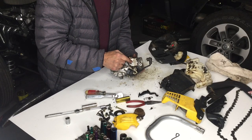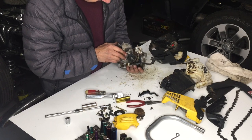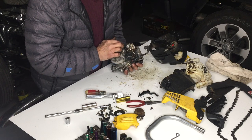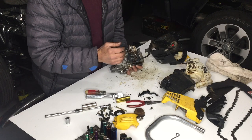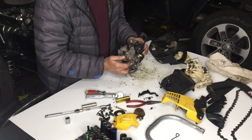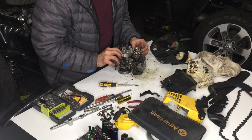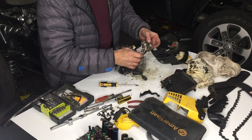In order to get this carburetor off now, the carburetor is mounted to the same plate that the magneto is mounted to. So in removing the carburetor, I have to remove the magneto. The adjustment on a magneto is a very fine adjustment — the key is to have just enough clearance that it doesn't rub on the magnets. It just keeps getting worse, not better. Alright, I took the magneto off. Well, the carburetor is finally able to come out of place.